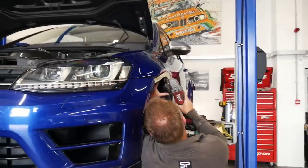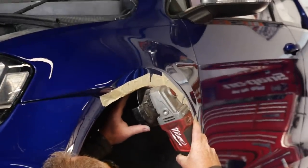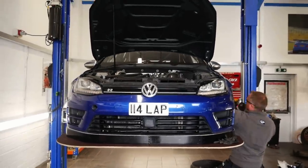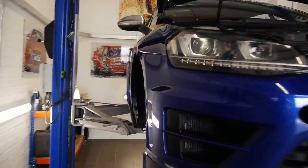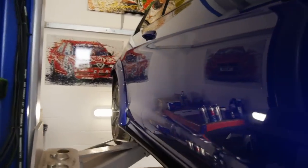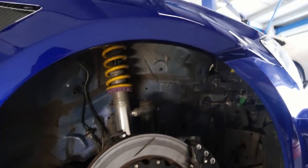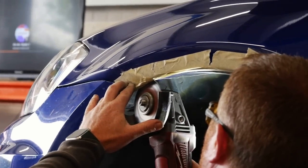Oh there we go — fully carbon wings being cut up, three-thread carbon. Not ideal, but race car, race car indeed. That side will be done, then this side, then we've got to fit the ABS sensor to the rear driver's side, and then it'll be time to get the wheels fitted. It is a horrible noise, all for a good cause.